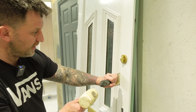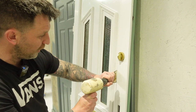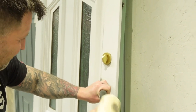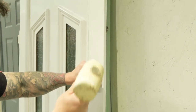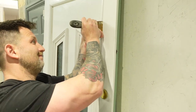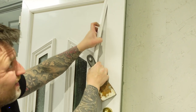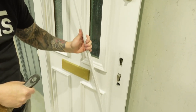I'll just put in the scraper at the edge here. What I'm going to do is go straight in at a tiny bit of an angle and start banging. You'll see the bead slowly coming off there, and as I get it semi-loose, what I'm going to do is put the scraper inside that and just lever it up like so. Once I can get a clear grip on it, I can pop my bead straight out. I'm going to do that all the way down to the bottom.